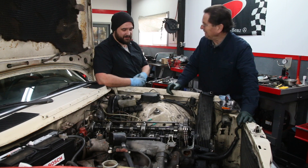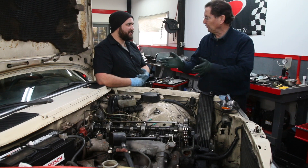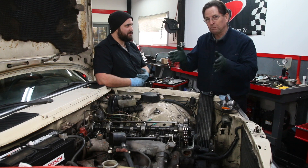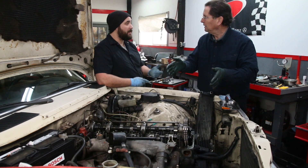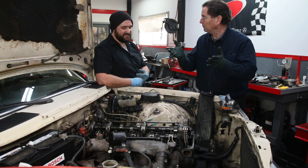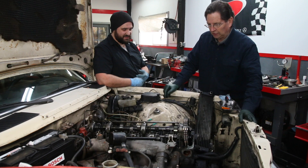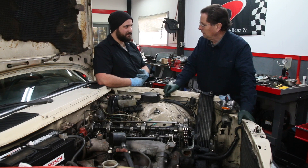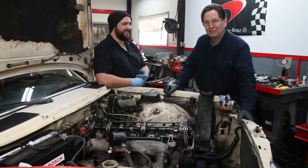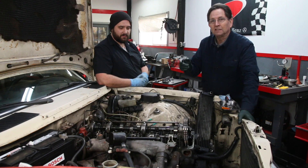I think the overheating is on the right track, but it's really about loss of oil. Some people don't realize that if you're running low on oil, even though you still have oil pressure, you could be creating excessive heat because the oil is not getting cooled down and engine temperature will come up. In all the years I've worked on these diesels, loss of engine oil is the number one culprit for catastrophic engine failure.